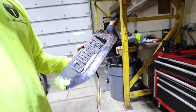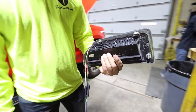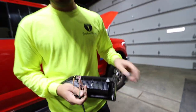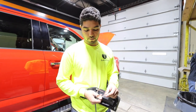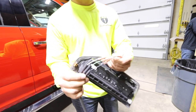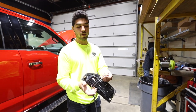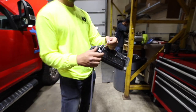We took the side emblem off and installed the X6 in there using stainless steel hardware. Right now what I'm about to do is heat shrink them. Here at Route One Industries we have a two-step system — we use the best heat shrink butt connectors by Permaseal. They pretty much ooze out, then we let them cool down for a bit, and we slide the heat shrink tube which also has adhesive on it. That way it'll provide double the protection against the weather. A little premium — I like it.